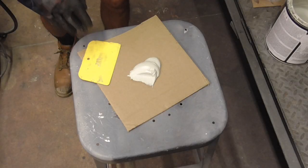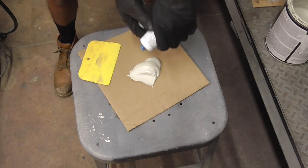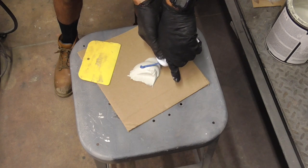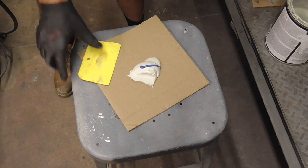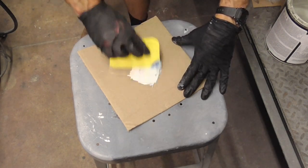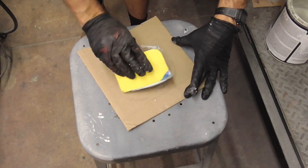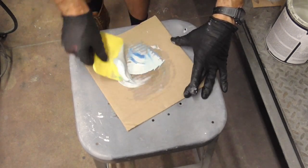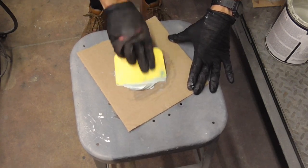There's really no difference whether you use a plastic spreader or a metal spreader — that's just a preference thing. To mix with the plastic spreader, you're going to stretch a line of hardener across the filler, stir it in a bit and mix. Get it off the spreader, go around, and the rules are the same.